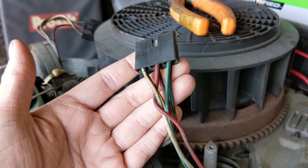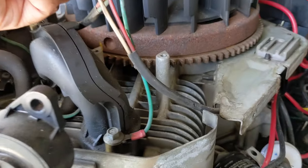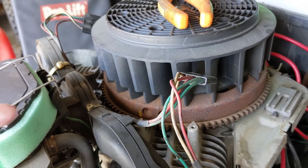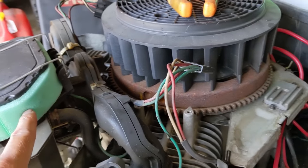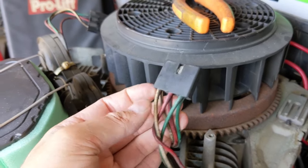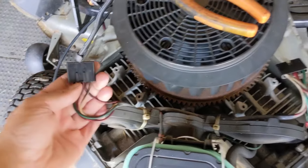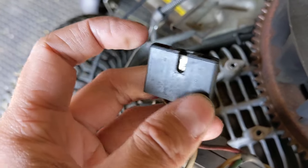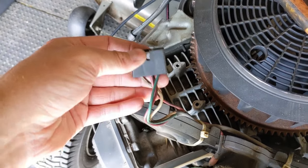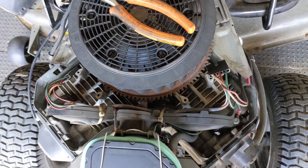The two ways you can do this: snip both the red and the white wires here, then using the red wire, wire in your fuel shutoff solenoid — that's the way to do it if you want to completely remove the harness altogether. However, that's a little bit more work. Kohler's instruction manual says to take the white wire off this harness and cut it as close to the connector as possible. That way, when you turn the key on, your fuel shutoff solenoid is still getting power, and when you turn the key off, both new ignition magnetos will get grounded through that white wire. You'd have to leave the remaining connector tucked out of the way, and since it's charged with 12 volts, cover it with electrical tape so it doesn't short to ground.